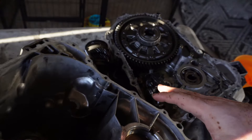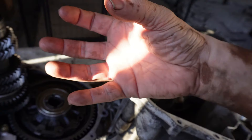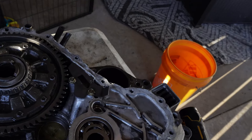I've taken so many breaks it's ridiculous, but we're back at it. Where I left off was cleaning the case - this is the B18 case, the top half. I'm going to put that on the B16 bottom half and I'm hoping the snap ring will snap into this case. It even looks different, it looks better, so I'm hoping it'll snap in since it snapped before. I'm going to finish cleaning this up. First thing I'm going to do is make sure I can get the snap ring on - if that works, we'll put some RTV on it, seal it up.